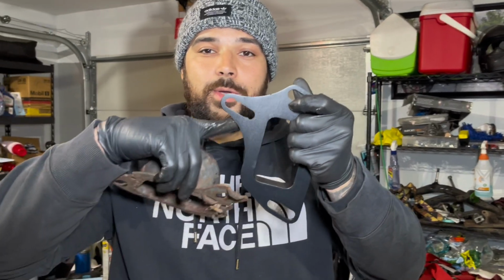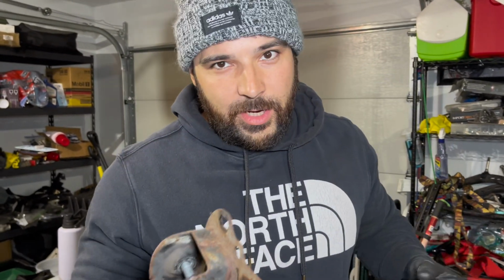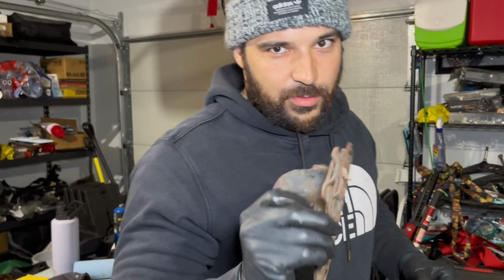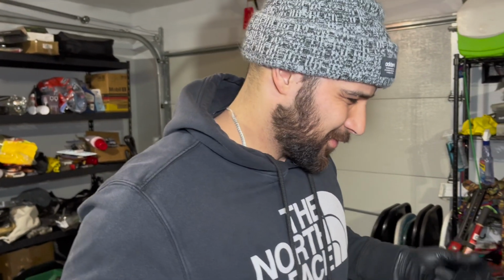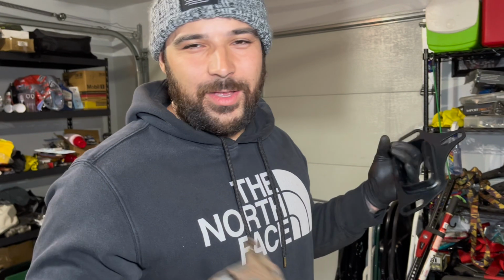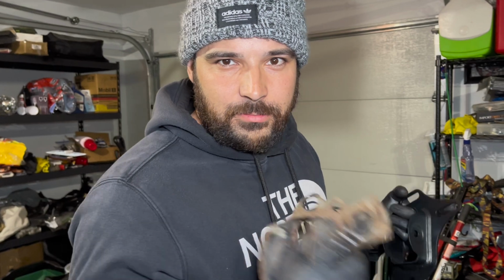So if that's not gonna do it, you're gonna need to put these on so that once you get the 3 bolts in for the trailing arms, you can actually move them. And in that way, go get an alignment from someone who knows what they're doing. This way, you don't have to just wing it yourself. Oh, like Pep Boys? Sure, Pep Boys fits fine, I guess. I don't know. Can they do that? Do they have a lift for that? Whatever. Get this, and then you can just toe them in, and now you have forward grip. So that's the magic, and that's how you lay the power down.